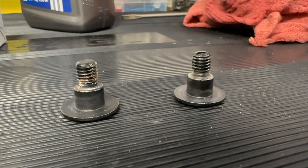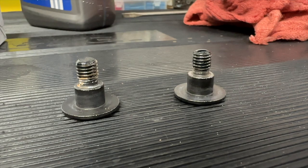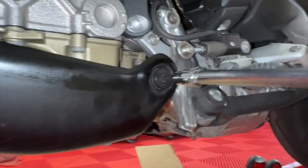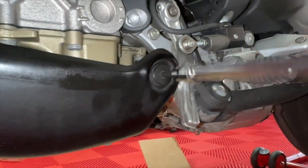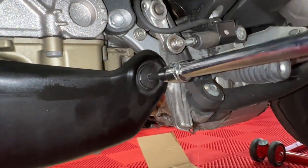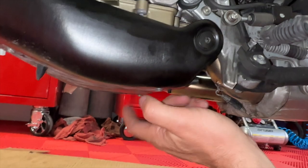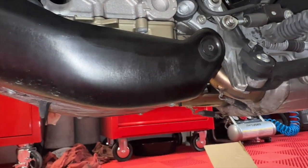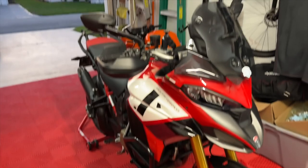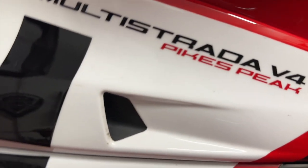Once you check for leaks a third time, put a little bit of Loctite on these and put your skid plate back on and tighten these back down. You're going to need an 8-millimeter for this. Make sure you have the Loctite on as I showed you. Make it good and tight, but don't overdo it because you're going into aluminum. Be very vigilant — be on the lookout for any drips the first couple miles you put on this bike because it's a fresh oil change. Take it off the stands, take it for a quick spin, bring it back and check again for leaks. And that is it. Please like, please subscribe — thank you very much and have a great day.